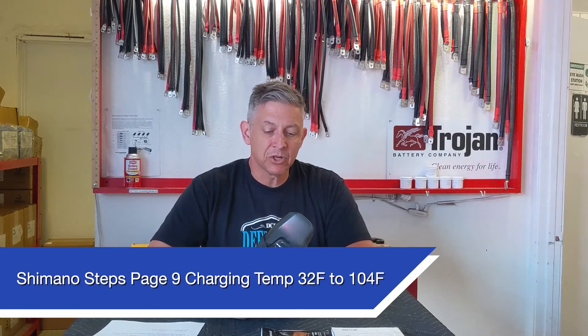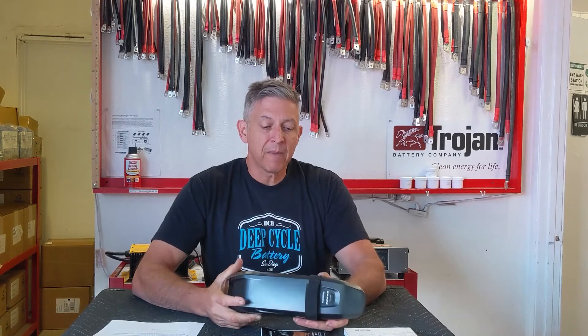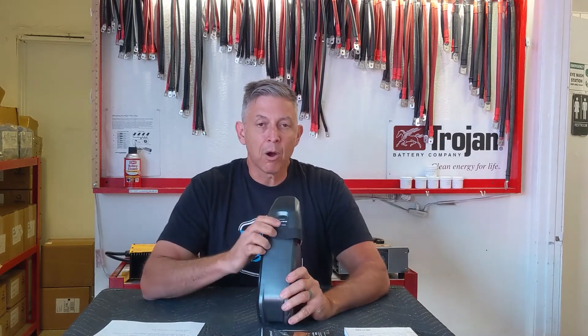When I got back home, the battery was still warm to the touch. When I plugged in the charger, it gave me an error message. Then I remembered the battery has thermal protection — it cannot be charged at high temperature. This is good news: the battery will not let itself be charged when it's hot, nor should we charge it then. The manual says if you live in a hot climate, do not charge this battery at high temperatures as it will hurt the battery. If you live in a very cold climate, the battery energy will not last as long — your bars will go down faster than in a mild climate. Cold temperatures suppress battery output.